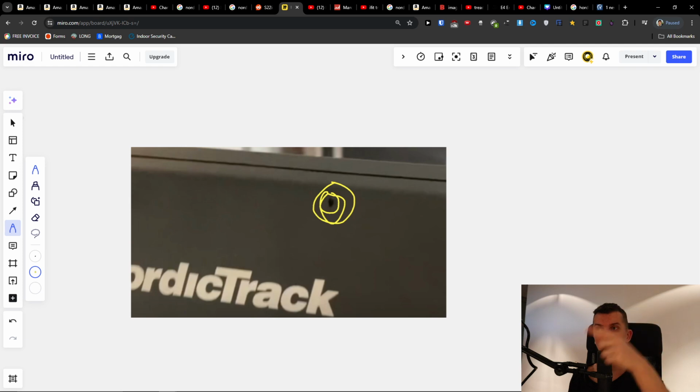So first you're gonna unplug the device. Then you're gonna find the reset from the back where you're gonna have the logo. It's going to be above the logo. You're gonna insert the paper clip into the pinhole there. While you're inserting it and holding it, you want to put it back into the outlet, turn it back on, and then the reset procedure is going to start if you're still holding it.